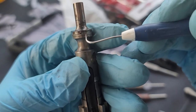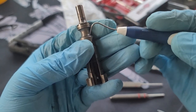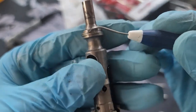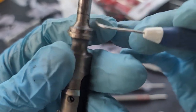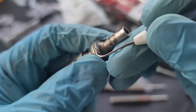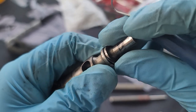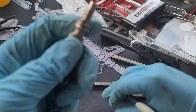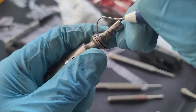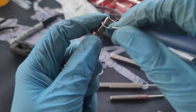Now let's remove the gas ring. It is recommended that you have some sort of small tool — a dental pick, a really small blade, or some people use a paper clip. It's easier if you align the gas ring, but if not that's okay. Just take out the gas ring — it has a little gap, so take that out just like that. Take the other ones out — you're not going to reuse them, so don't worry about damaging your gas rings.